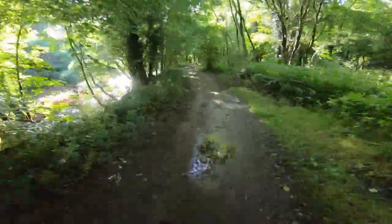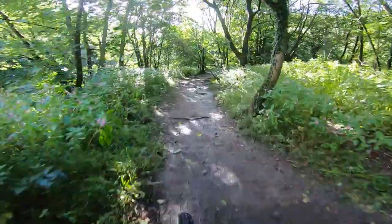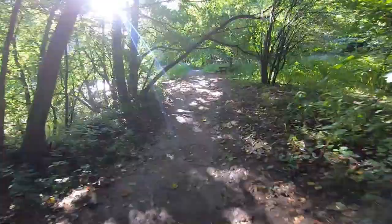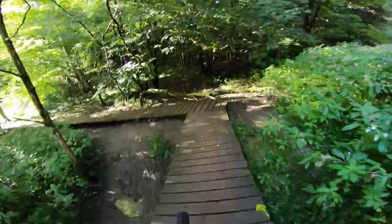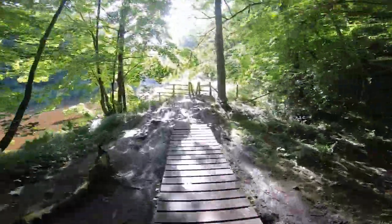There's just no specific agenda to the geometry really. Head angle is 65 degrees, seat angle 74, and on this large the reach is 460mm — you could go a bit longer. The medium is definitely short at 437mm, but it just centers you really nicely on the bike. There's enough stability in the front for speed but it's tight enough for little greasy slow-speed sections like that.